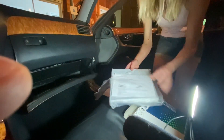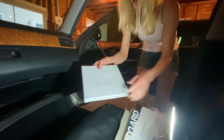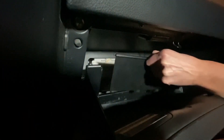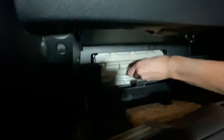The car is freshly clean. We're taking the new filter out of the box. We have to get rid of the old one, so we're gonna go into the glove box. Now, there are two glove boxes in this car — you're gonna want to go on the bottom one. There's this piece you're gonna pull out, and leave it down there so you can retrieve it. And when you look in here, you can see this is where the filter is going to be.